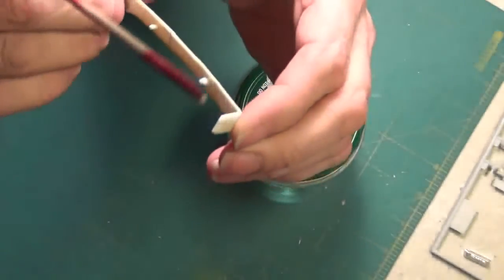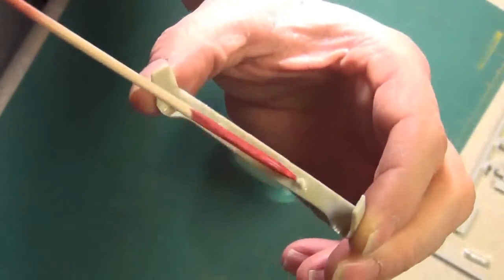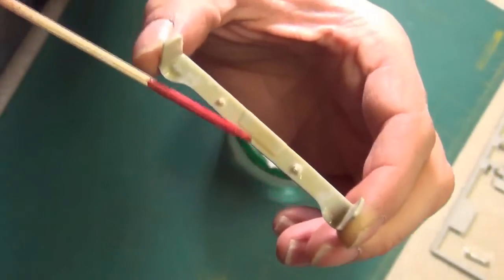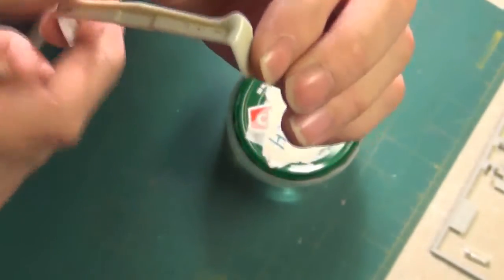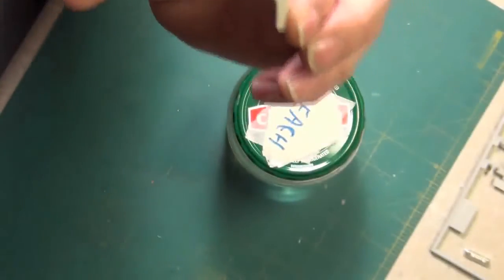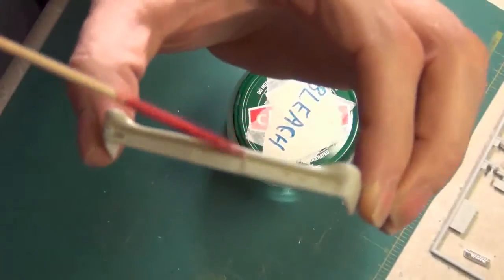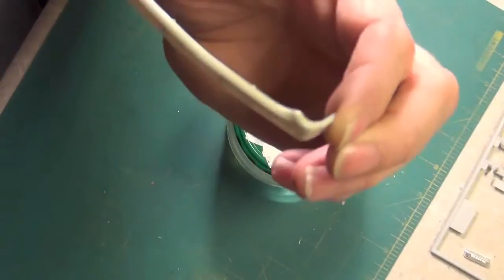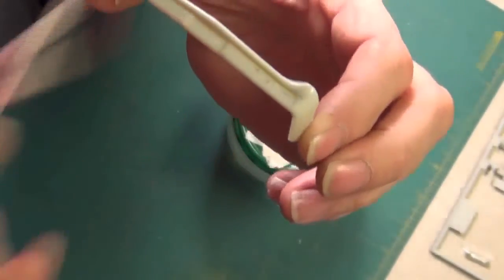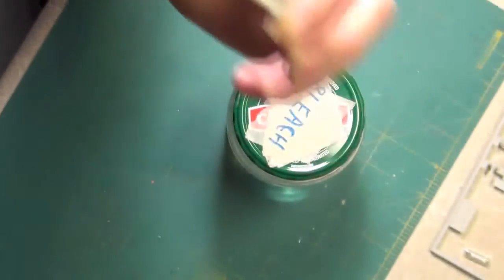If you look on the back side of this bumper, you can really see it, where it's pooled up, all that yellowish brown stuff. This part is completely covered with that lacquer, and if you really want to strip a part well and get detail out of it, you want to get rid of that undercoating. That undercoating is the key. Once you get rid of it, you're going to have a really nice, crisp part, all right?